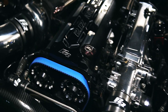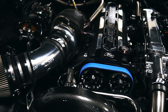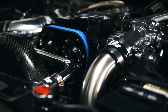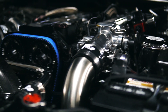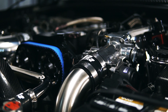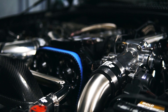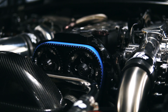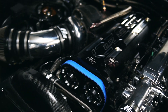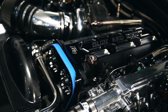If you've heard these engines with the GSC S2 cams, they sound amazing. Overall very happy with the whole setup. I'm still running a stock ECU with a small piggyback on it surprisingly, and even with these fairly large lift cams it still works. Cold starts are a little rough — it seems to want to stall out and die at some point — so I'm still fiddling with the piggyback to see if I can get it any better, but so far I've been able to get it up and driving around.